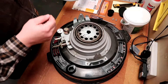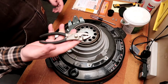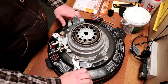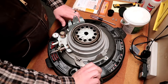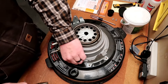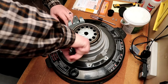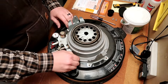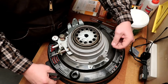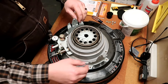Inspect everything as you go. Next we're going to need a pair of pliers to loosen the four wing nuts around the wick housing. Pretty much guaranteed you'll need pliers for this if your heater's been running for any amount of time with all the heating and cooling it's been doing. I'll skip ahead a little bit and get into that last wing nut — that should release the wick housing.